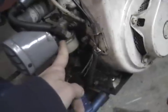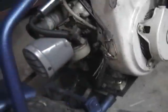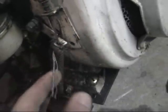This carburetor, we've had probably the most problems with this out of the whole bike. There's so many adjustments and all that, and there's probably about 4 springs. There's one here, one going down here, a couple back behind here, and it's kind of hard to see. And they all have to be in just the right hole, because if you look really close, you probably can't see it on camera. But there's multiple holes for each spring to go into, and there's probably 40 or 50 different combinations. And we had to figure out exactly which ones they went in, which took quite a while, because if you didn't have it in the right one, the governor could be in the wrong position and burn too rich and whatnot. But we think we have it figured out, and it sounds good.